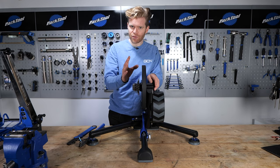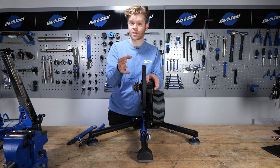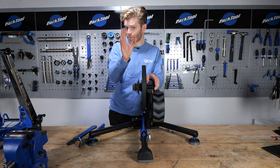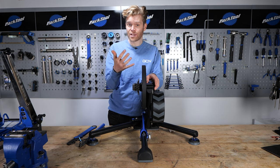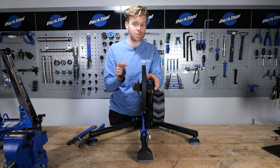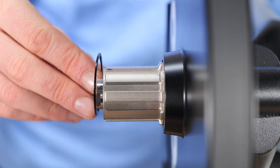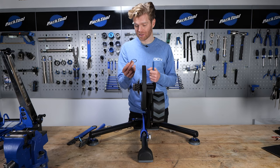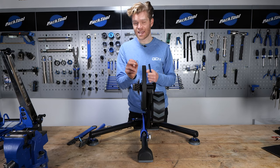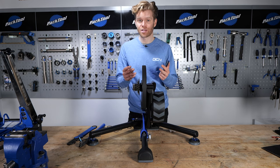It's important to remember though, if you are spacing out your cassette on your bike wheel, you'll need to re-index the derailleur on your bike because now that derailleur at the back will be set in a different position relative to the cassette on the bike. Your gears will be out, so you'll need to re-index them — make sure you do that. As mentioned, when you're spacing out the cassette, it's not by much. Usually I've found that just a millimeter is sufficient and not much more beyond that. The key thing is take your time when you do it, make sure that it's all working properly. You'll be glad that you've taken your time when you get it fixed — it's well worth doing.